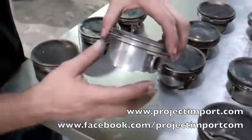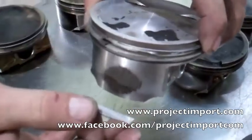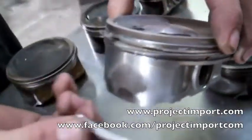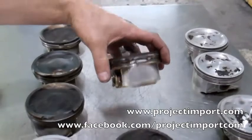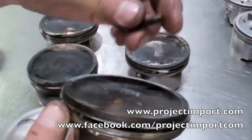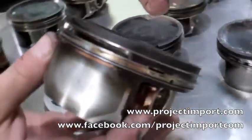Or, the ring-land cracks begin, and then as you can see this piece was in there — that's how we found it. So those small cracks turn into actually cracking underneath, and then turns into the bigger stages of eating this piece. There's another one where we found a piece; this was in there, and it slowly over time would have eaten this piston.